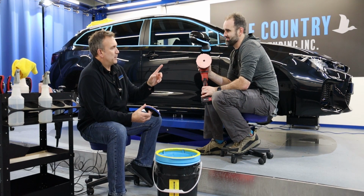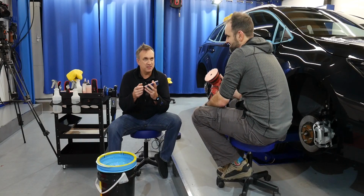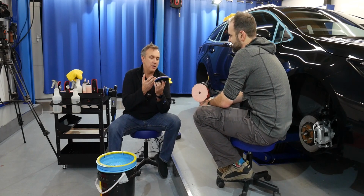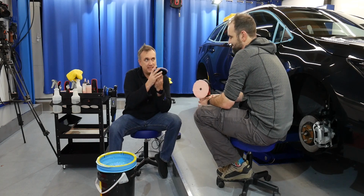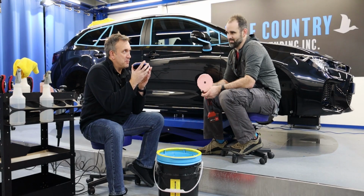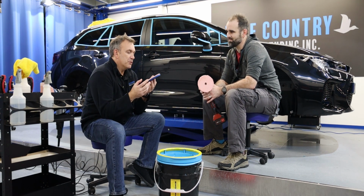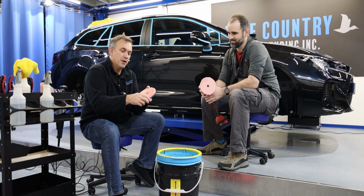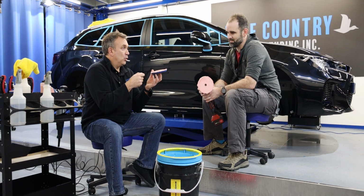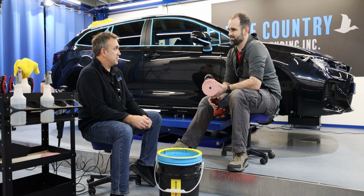So remember, we've discussed earlier that a foam pad is shedding compound. So it's almost slightly self-cleaning because the foam doesn't attract the compound. Whatever compound you use, a microfiber pad is going to collect. So these clog much faster than a foam pad would. But these are much harder to clean, because if we try to brush this now, it'll stay there. So traditionally, you would either put these in a washing machine or under a sink, brush them with a load of Fairy liquid or detergent, and spend a long time cleaning them, or use a blow gun, literally an airline.